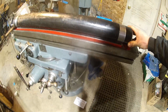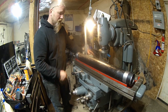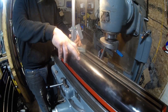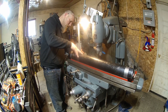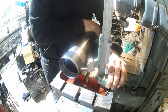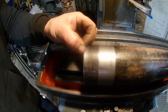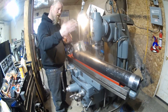What I'm doing here is sticking this right in the V groove of the mill. At this point we're going to run a line across the drive shaft to keep our phasing correct with our yokes that we just punched our marks on. I'm using a height gauge — set it close to where it's going to touch on the center — and I can scribe a mark on either end to line up our yoke. This mark here that you can see is in line with this mark down here, and I'll punch those so that they're visible when we bring the pieces together so that everything is in line with each other.